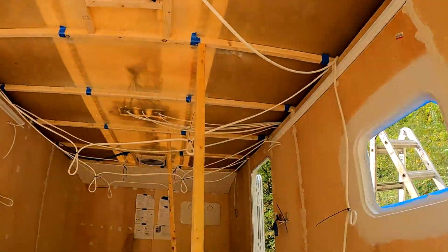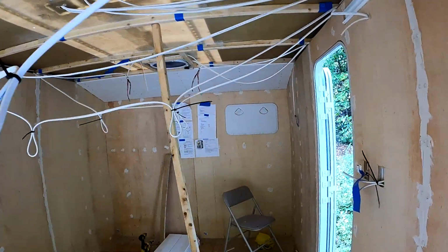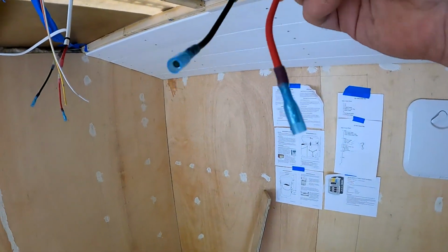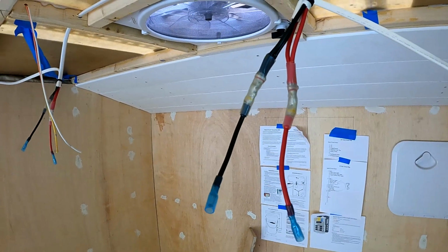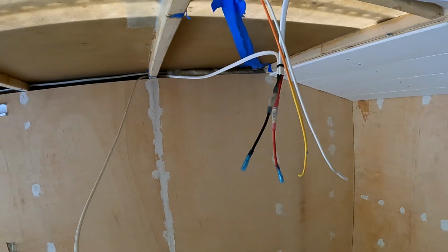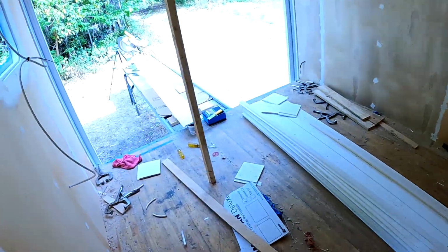So I got some wiring in, which I'm gonna let that ride. Managed to get a couple of pigtails complete here. These will be for the 12-volt lighting, 12-gauge wire overkill, but didn't want to have any major issues with the run because it is rather long. So there'll be a pigtail like that on each one of these sets. So they'll poke through the ceiling, and then I'll worry about that later.